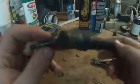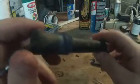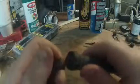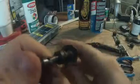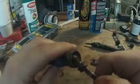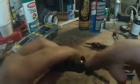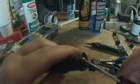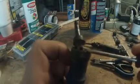These are the Summit axles. The difference with these is it has a CV joint, like front-wheel drive vehicles. A lot of them use CV joints, because it's independent suspension, and this is kind of modeled after that. Sorry for the lighting, it's terrible, but as you see, even at your most extreme angle, it stops and rolls pretty smooth, at least until you get to this point right here. It's got a little bump where the pin sits.